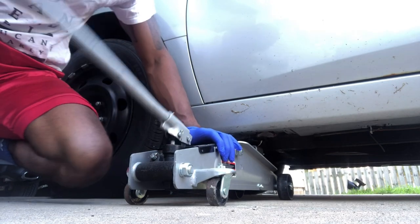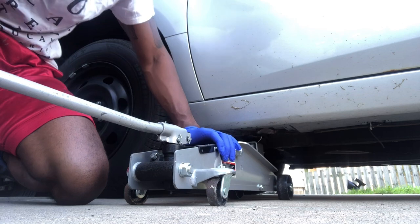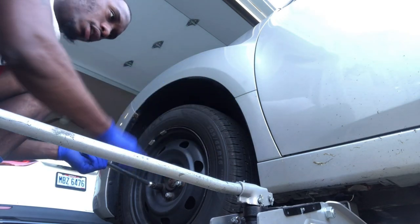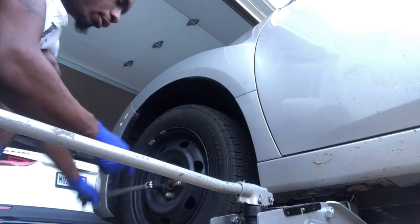If not, there are videos — I've got videos too. So I'm only going to halfway show it. Really we just want to get to a point where your car begins to lift, but we're not going to lift it all the way up because we still have to break the lug nuts off first. Since we're on the left side, think about it — unloose this way, so we go this way. We're going to do that for all of them.